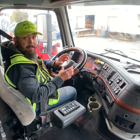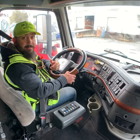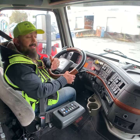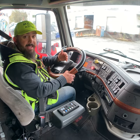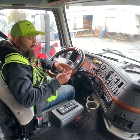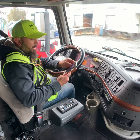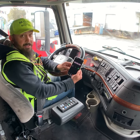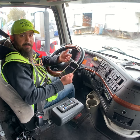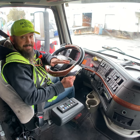For all of them: test name, explain, do it, result. Number one, test name, air leak test. Explain, the truck can lose no more than 4 psi in 1 minute. Do it. First, excuse me, sir, could I use my phone? Bring your phone out, go to clock, go to stopwatch, and be ready for the tests. You can use your watch or a timer. Just don't forget, you have to time 1 minute, not less.